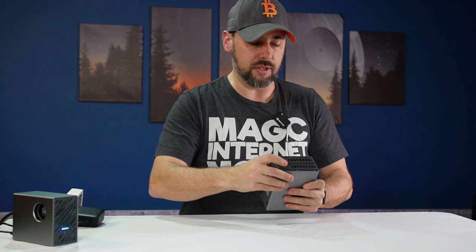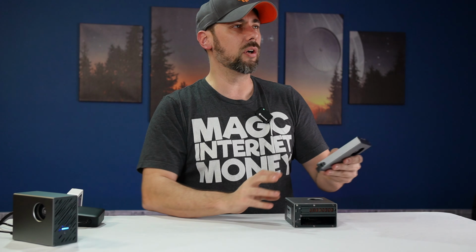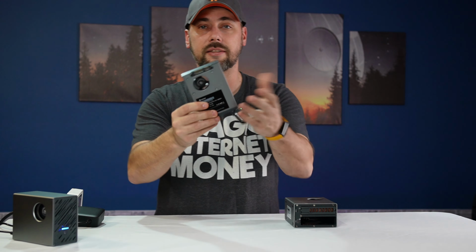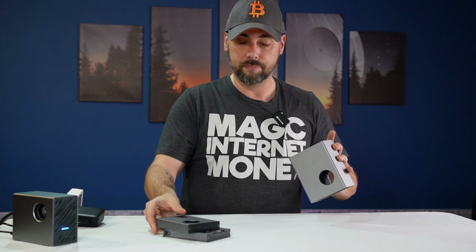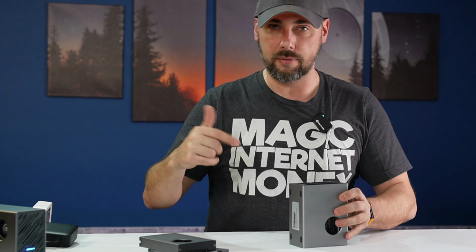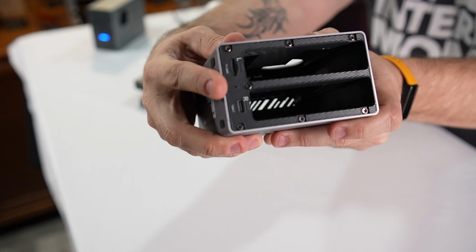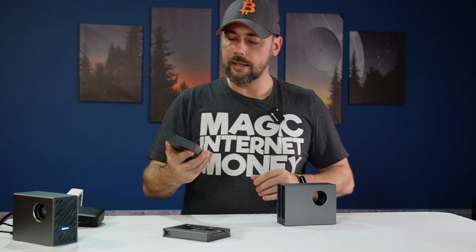The reason I thought it was a NAS is because these are cards. And the cards have a SATA connection on them, like an SSD or a hard drive. And they really are about the size of a 2.5-inch hard drive. There's two of these that came in the chassis, pre-installed. All you had to do was plug it in. Well, you had to reset it when you plugged it in because mine wouldn't boot up right the first time. The reset button's right there in the middle, by the way, in between the SD card slot and the USB-C power input jack.